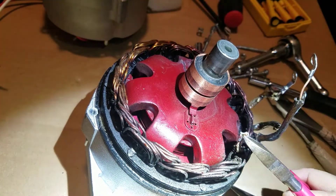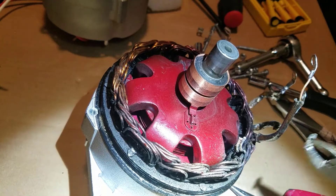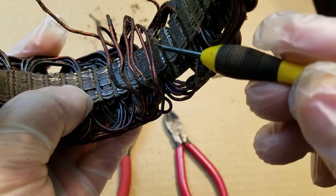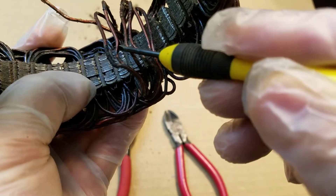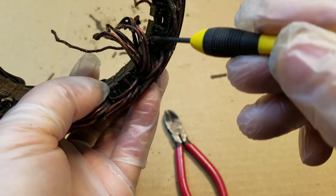This is a refurbished car alternator that can produce a maximum of 55 amps. And we're going to tear it apart and modify it. This particular stator winding has 6 loops of copper wire, and we're going to multiply the loops of copper wire by 10, so we're going to have 60 loops.